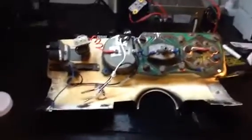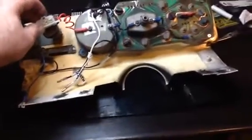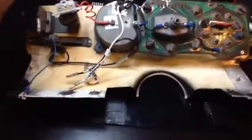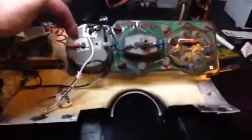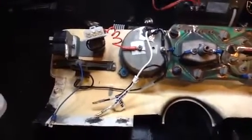I'm not finished with this yet — I just did a rough sand and paint on it to see what it would look like. I've still got to go back over it with 1200 grit. Another thing I've done with this dash is my fittings finally came in and I was able to wire up this area here. I've wired the clock looking at the schematic. The difference between the Australian and US versions is that the Australian version's clock doesn't come in through this 6-pin fitting. So I've just wired it up like the US version, because it isolates any positive wires floating around behind the dash and makes it nice and secure.